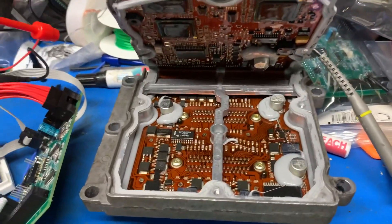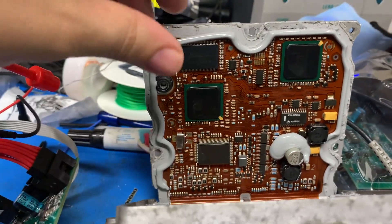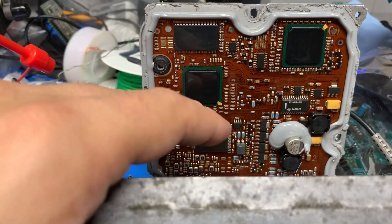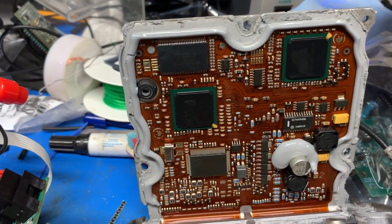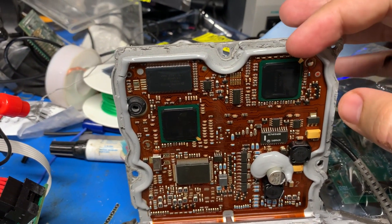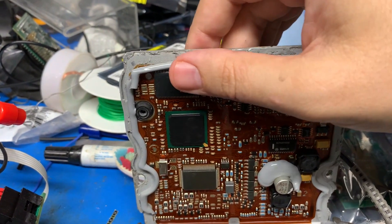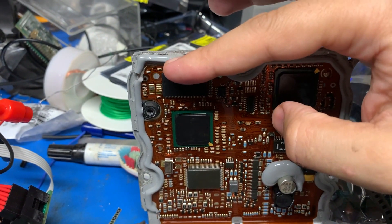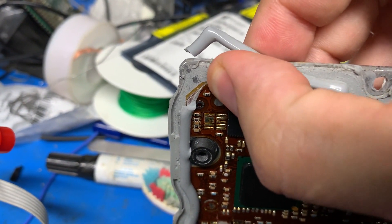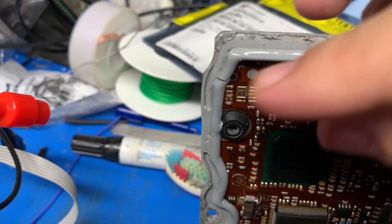Now that we've opened up the ECU, let's talk about how this thing is designed. All your microcontrollers — I believe these are Motorola, now owned by NXP by way of Freescale — we have two main microcontrollers here and then some RAM and ROM chips on this side. One reason you want to be careful where you shove your screwdriver is that if you hit one of these chips it's game over — these are BGAs, and if you damage them that's a serious problem. I did slightly knock the gasket, which we'll replace with silicone anyway, and I got my screwdriver just under the corner of the flexible circuit board, but it's okay — it's not under a BGA section and I checked the traces, nothing's damaged.